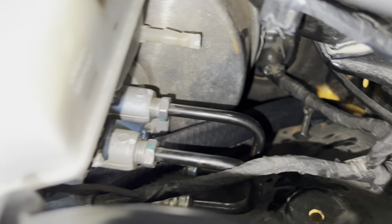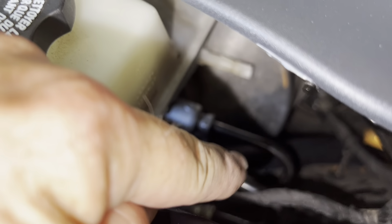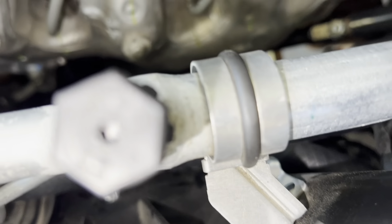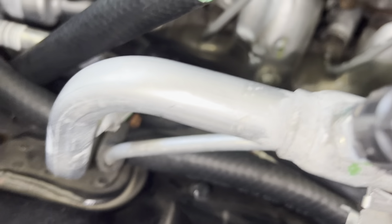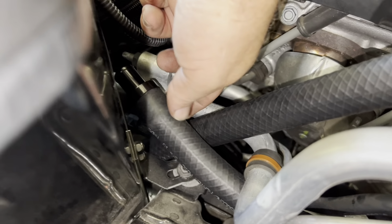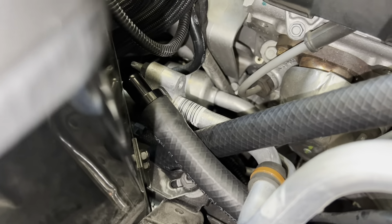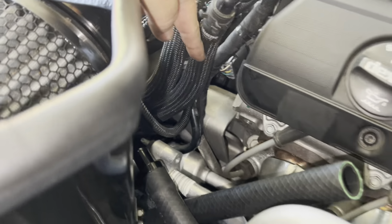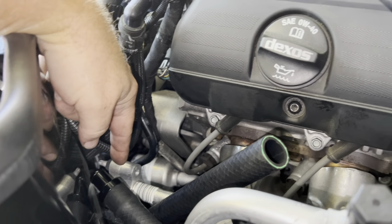Come right through there. Right through your brake hoses. And around the strut tower. And I put mine behind these AC hoses here. And mine ends right here. And there's the fitting where you tap in to this hose. You pull this hose off, put it on there, bring this one over, and hook it up